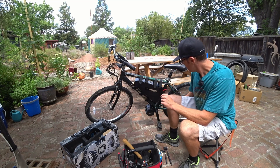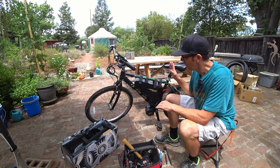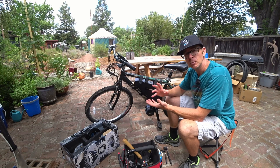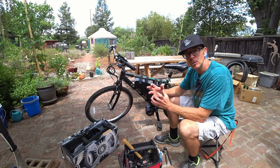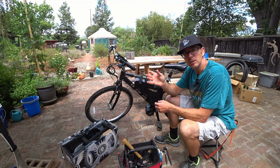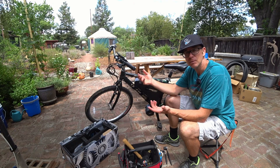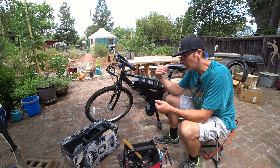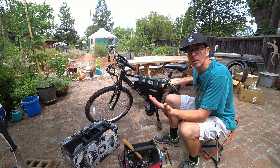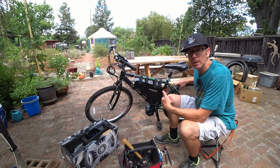The last thing component-wise: the rear wheel on this is a mess. When you have a lot of power pulling through a mid-drive, you need to make sure your rear cassette axle is solid. This one actually has some interior bearings that are toast. I'm going to see if I can repack them and check if it's salvageable; if not, I'll probably just have to get another rear wheel. Being a 26-inch rim, it's pretty easy to find a nice used rim to replace it if I need to.